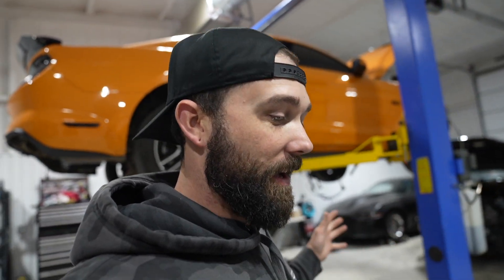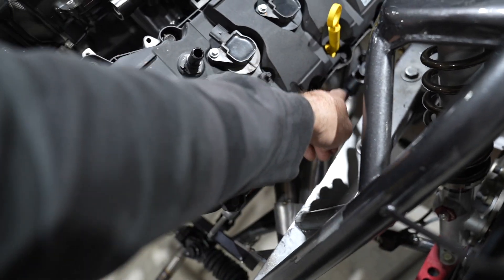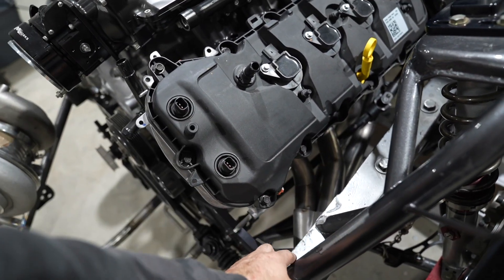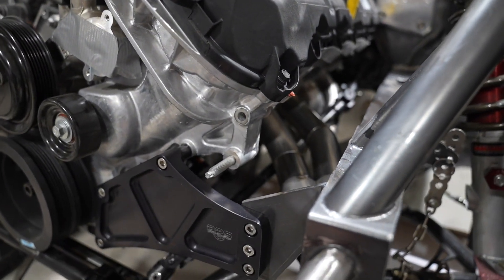Been grinding away in the shop. Joe's got the last primary done on the driver's side header, and I was really keen on making the headers symmetrical — that's what he's been working on. I know it's been driving him crazy, but that's how I wanted it, and Joe, that's what he does — he produces when you ask for something. We've got the fourth one in there, and it has to drop pretty low because the steering shaft comes through there. Joe's not super happy with how that one came out, so I think we're going to try and raise it just a little bit.